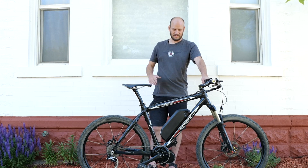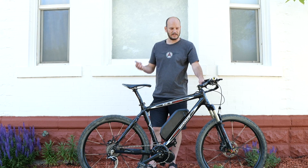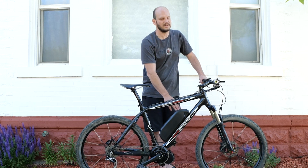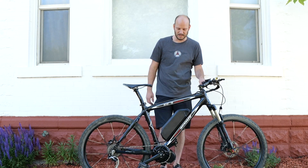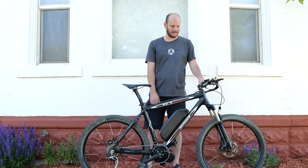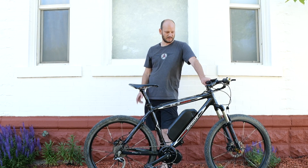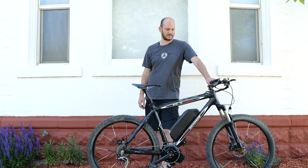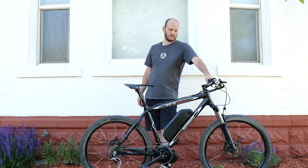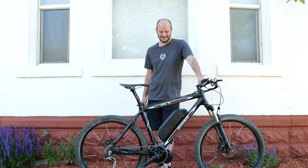The bike climbed a 30-degree hill with just throttle, no problem — I felt like I was almost doing a wheelie the entire time. Top speed was 34 mph, and the battery was only at about 52-53 volts, roughly 60% charge, so it might eke out another mile or two fully charged. Mid-30s is what you'll get with a BBS HD on a bike like this. Links to all the parts are in the description, and check out johnnynerdout.com to support small business.